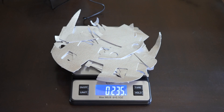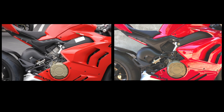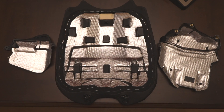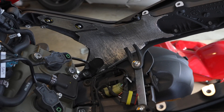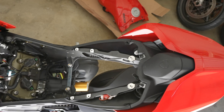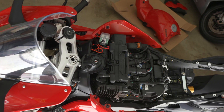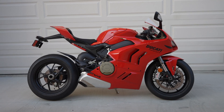The kit comes with all the heat shielding and a new right-side engine cover. The new engine cover is about two or three inches longer, giving you a little bit more heat protection. At the end of the process, you'll have heat shielding on the bottom of the seat, on the inside of the side engine covers, and on the inside of the subframe — all combining to shield your body from the heat. Because it's a little fiddly and requires removing the gas tank and using a Dremel, I'd give this a four on the difficulty scale of mods to do. I'll link some helpful install videos in the description.